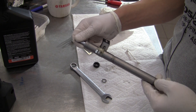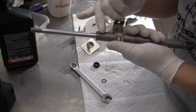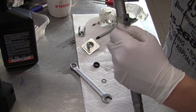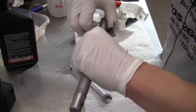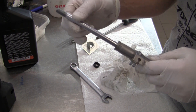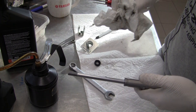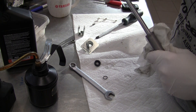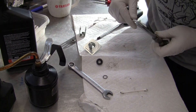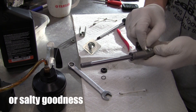I've been playing around with this — to me it doesn't look gas actuated as much as mechanical. If we push here we've got the cylinder thing come out, but you can't really dismantle it because it seems compressed and pressed. One thing I see that could potentially happen is this plastic could get wedged into the slot, so if it was stuck in there you may not be able to open it up. Generally it looks like it should work for a while. I'm putting a tiny bit of engine oil here and wiping it around. The shaft does turn inside, so I'll get a toothbrush and clean this out. Okay, so that's clean now — I'm not sure how this works inside but there's no reason it shouldn't work for a while. If this seal is no good you might end up getting some stuff in there and scoring it.